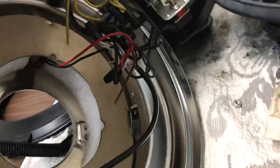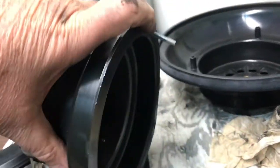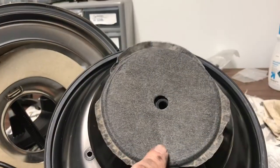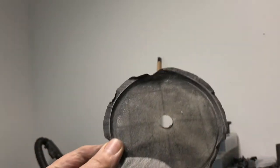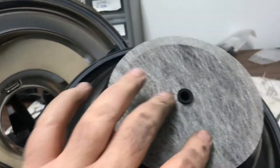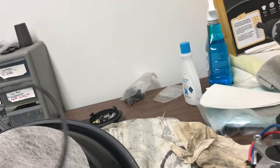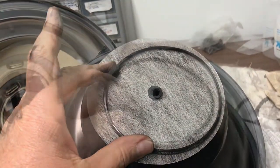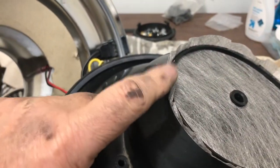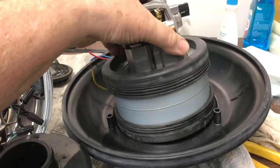We've got the white filter in and the retainer in. Here's the good part — here's why you cut the wires off, because now you're going to put the motor back into the housing. Wipe that area out too — everything has to be wiped out. Put a new motor guard on the bottom. You can see how nice that is when you put it in. All those odors and filth have to come out of that machine to make it right. It does take a couple hours to do this — the video is edited so you can see what to do without dragging it out. Press in the motor guard, put the snap ring on, and snap that back in place.